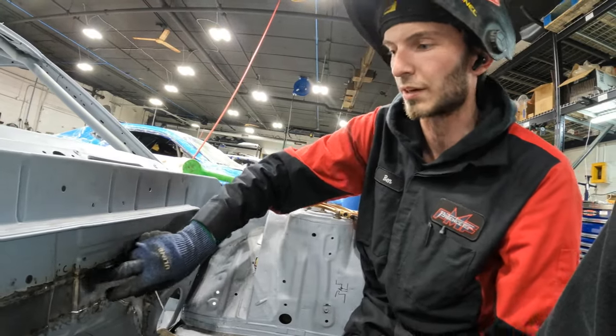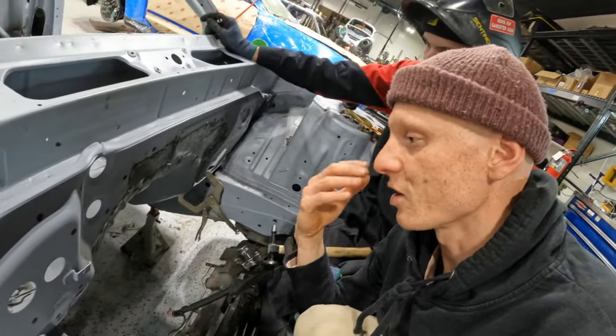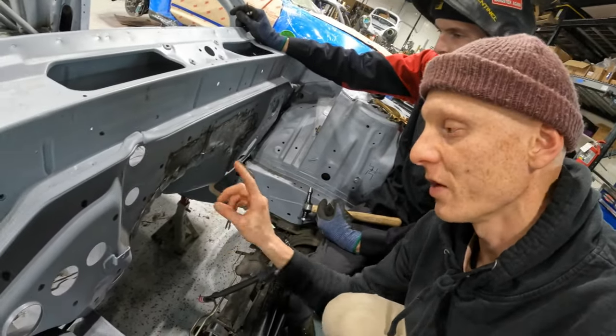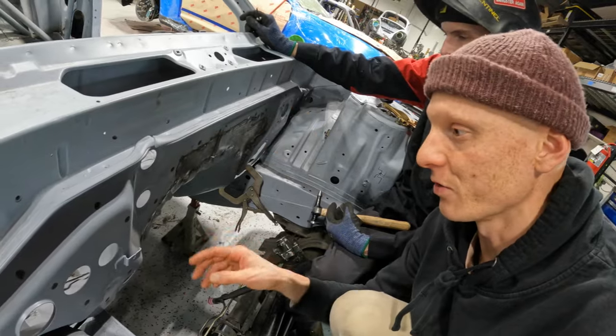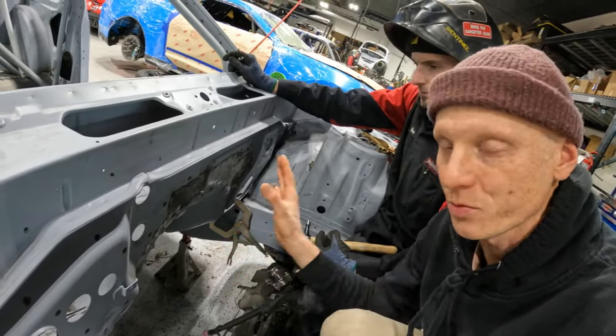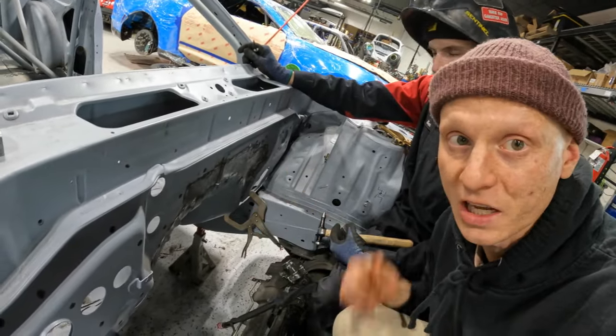So once we grind it and paint it, you won't even know it's there. It's a laborious process — he has to go inch by inch and then go back and forth between welding, adding heat, and then stretching it back out so it doesn't malform. If you were just to do one entire bead around, it would be a huge mess. At the end of the day, we want someone to look at this after it's been painted and not be able to tell that these are two different firewalls that have been merged together.